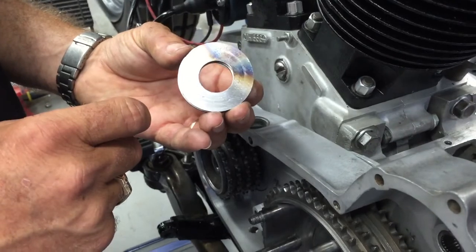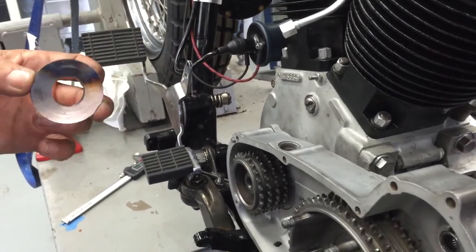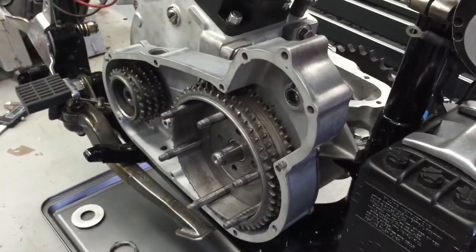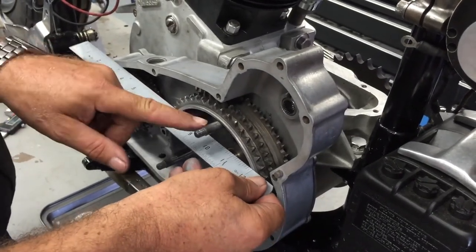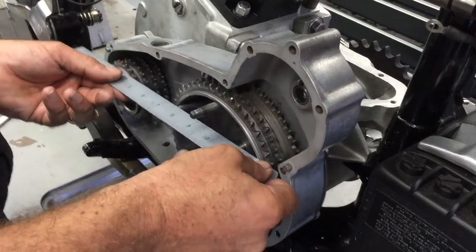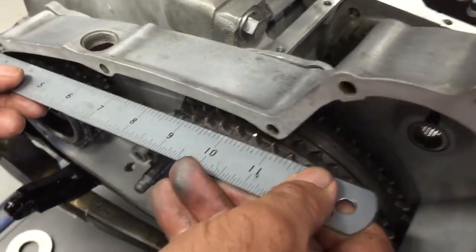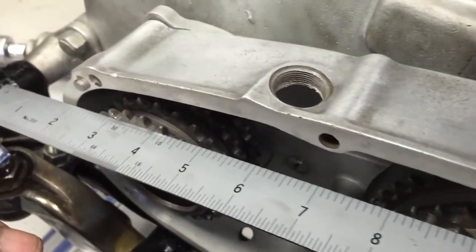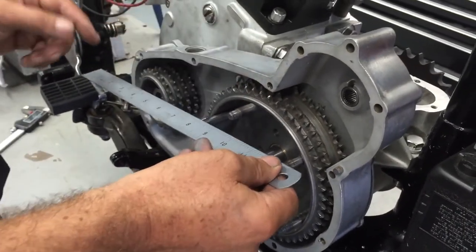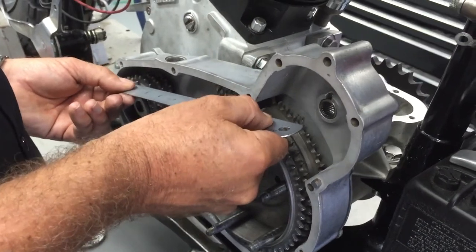You can tell things haven't been set up right when you can see blueing like this, which means it was set up with too little clearance — probably didn't have any clearance at all — and it just generated so much excessive heat. We're lucky in this case that we pulled down this client's transmission, because the whole thing hasn't been set up right from the get-go. For now we're just putting the engine sprocket and clutch sprocket on, then checking the alignment. Indian actually calls for the alignment being done out here on these outer machined parts, but I like to do it across the teeth, because the bottom line is it's the teeth that have to be in alignment with each other.